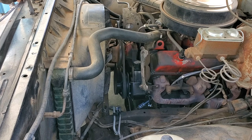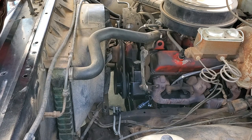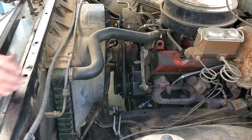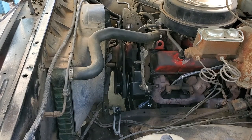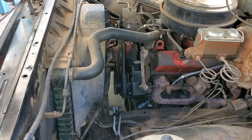Here we are looking under the hood. As you can see, most everything is dirty and grungy. Our current plan is just to get everything working nicely — it is certainly drivable right now and we've been driving it. The one thing that's real nice under here is we had to replace the power steering pump. The power steering pump was completely shot and leaking like a sieve. So we have a new pump. For people who may have never done it: this vehicle is about 43 years old, so if you're going to replace a power steering pump, don't even think of reusing the hoses. Both the high pressure line and the low pressure line have been replaced. We have zero leaks now and power steering works perfectly. That's the one major repair we've had to do so far to make it drivable.